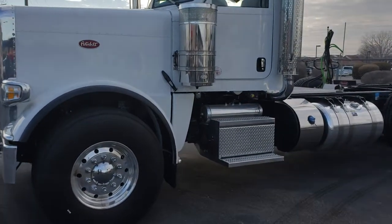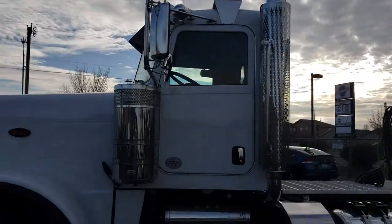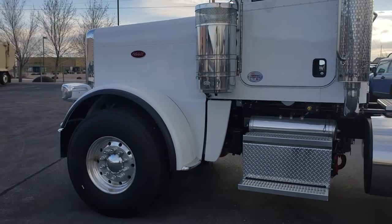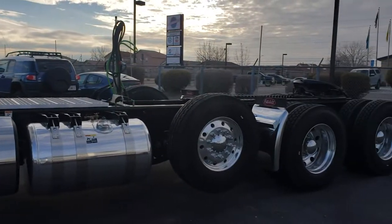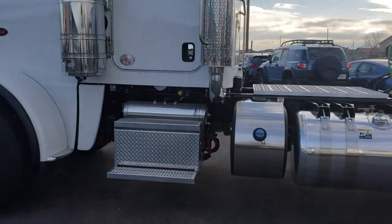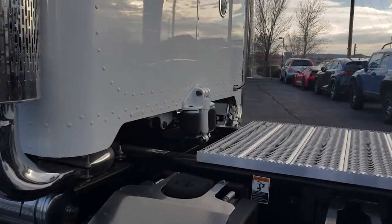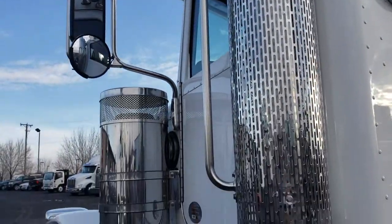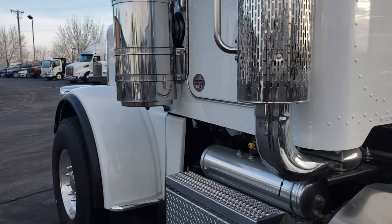The 389 short hood — you're probably wondering why a short hood on such a big truck. The truck is a good-looking truck but it's meant for performance. It has an X15 performance engine — 565 horsepower, 2,050 torque. The four-axle builds we used to do were about 301-inch wheelbase; this is 279. Customers complained the turning radius was too wide, and that they spent money on a 20,000-pound front axle but could only get 15,000–16,000 pounds to it due to the long wheelbase. Shortening the hood saves weight, saves money, gets more weight to the front, and the shorter wheelbase does the same.